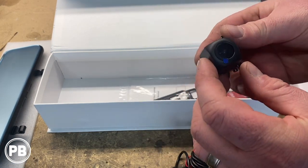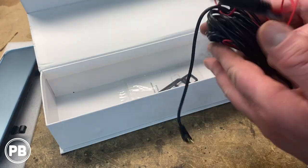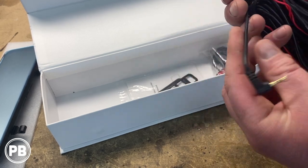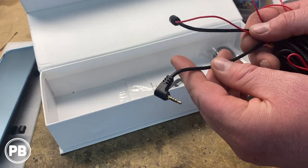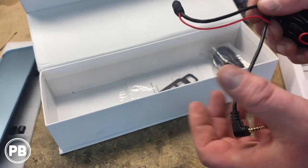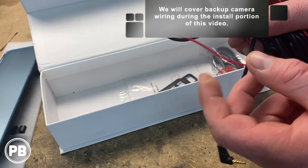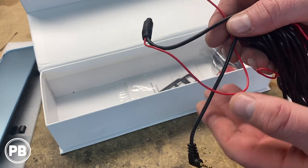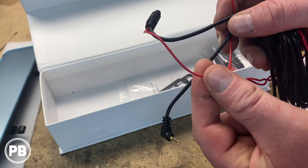Next here is our backup camera — here's the camera they supply within the box. This camera itself has a little pigtail, and we'll show you how that plugs into the rest of the harness. The big black one here is your video feed — it's nice and long, and essentially this will plug into the top of your mirror, supplying the camera power but also providing the mirror the image of what the camera is displaying. Now this long red wire is your trigger wire. In order to tell the mirror when you're in reverse, this needs to tap into the positive wire at the reverse light. You just need to identify where that is in the vehicle — it could be on a smart harness back behind the radio, in the kick panel, or at the taillight itself. This needs to go to a reverse light positive.